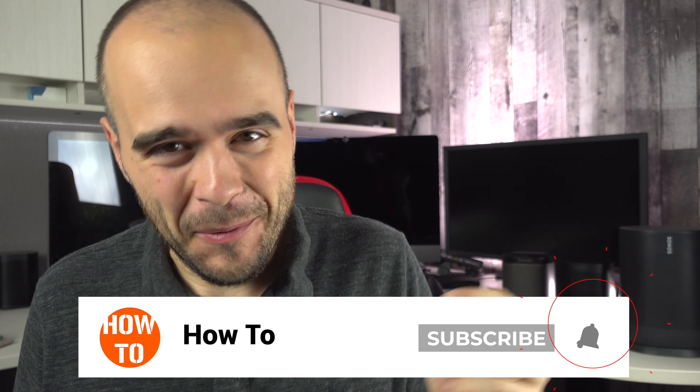I heard a lot of people complain about the fact that the Sonos Arc only has one audio input, which is the HDMI. But yet, it's largely enough. The idea is that you connect all your devices to your television — your Apple TV or Google Chromecast, your PlayStation or even your cable box, dish, or DVD player. And automatically, when you select the input of that device on the television, the optical output or the HDMI Arc output will send the audio back to your soundbar. So basically, thanks to a single wire, your Sonos Arc has as many inputs as your television has.